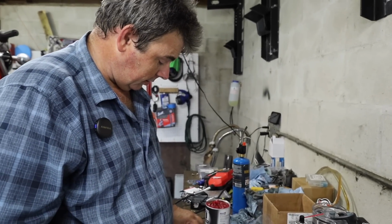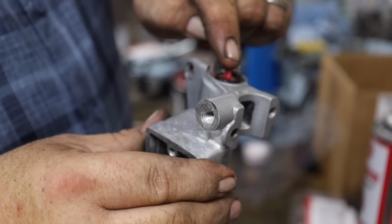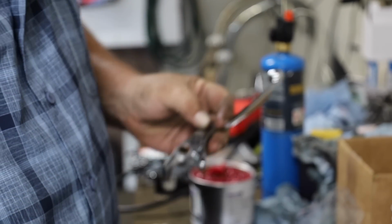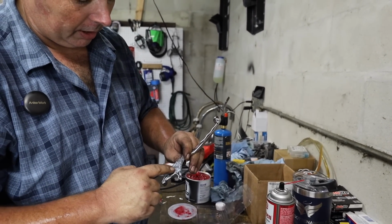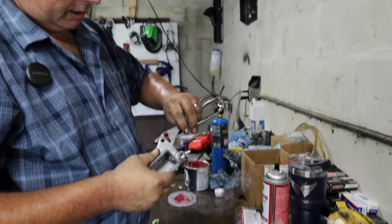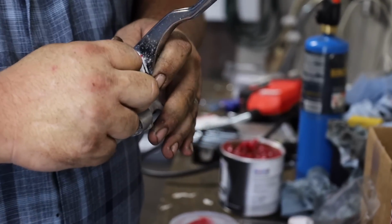Before you put the lever on there, take a little tiny dot of grease, about like that, and just put it right there on the back of the plunger for the master cylinder. That rides right there, and whenever that gets dried out, I'm going to go ahead and put a little bit here on the sides of the lever here where they pivot in the side of the master cylinder too, just for general principle. Again, it doesn't take much. When you put that in there, right like that, and then you slide your pivot pin in, everything's nice and free.